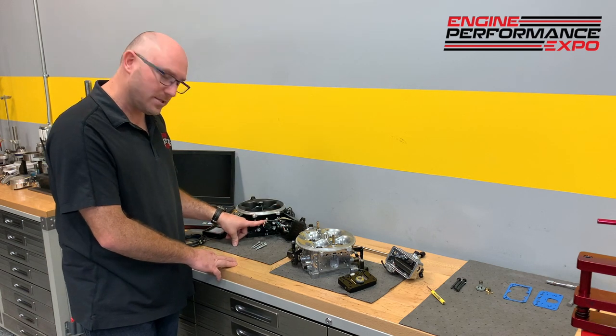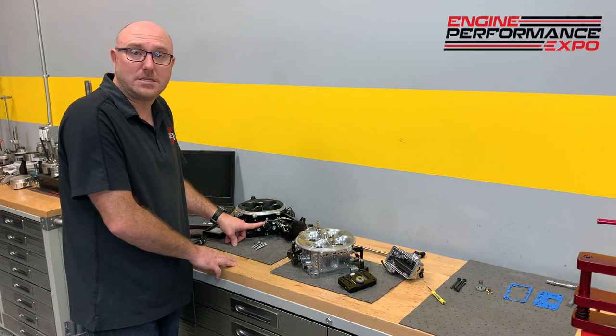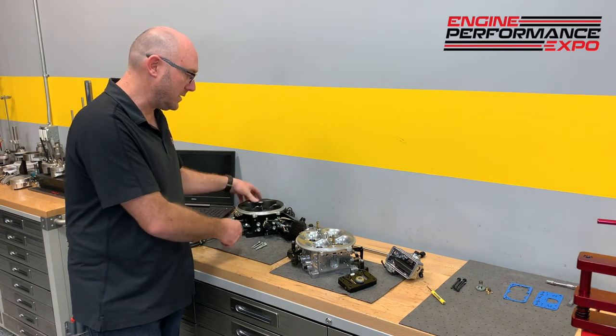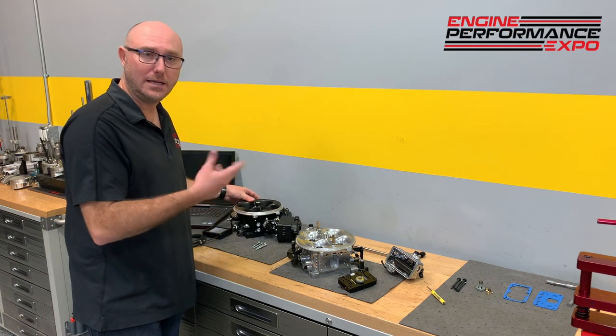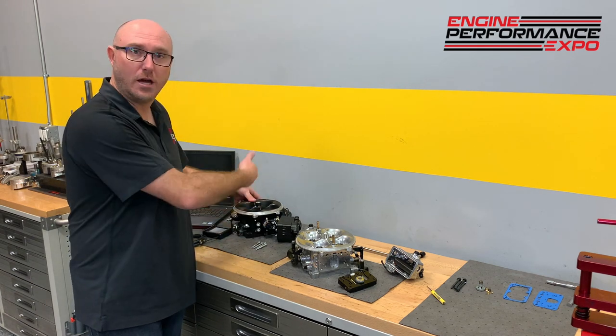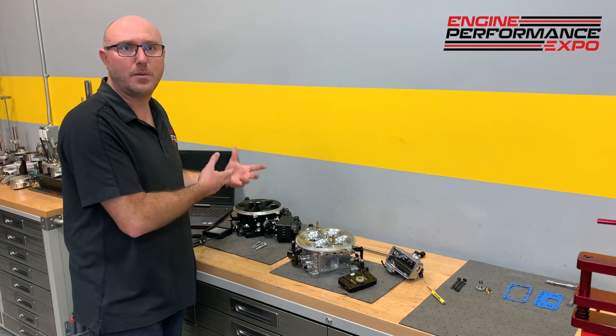And then this little electric motor here is controlled by the computer. That's basically a plug that opens or closes the idle bypass restriction. So if I want the idle speed to increase, it just takes that little motor and uncovers the hole and more air bypasses. And of course, it's dynamic. It can happen in real time.